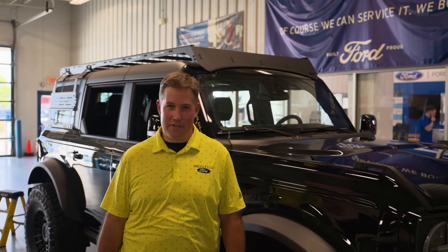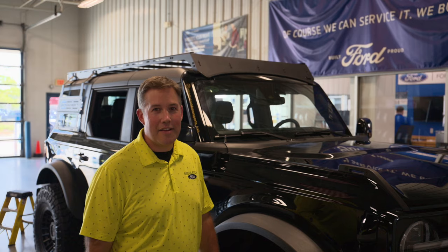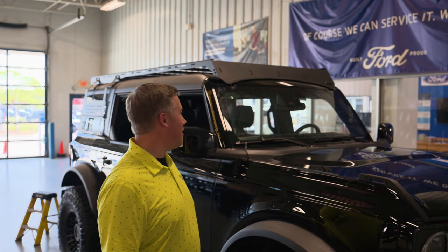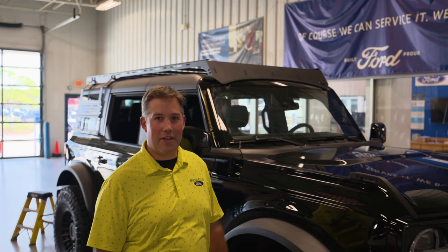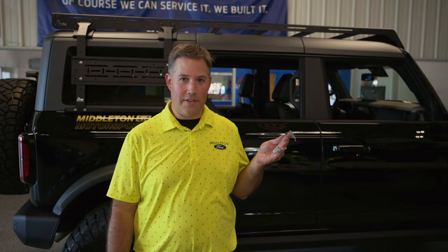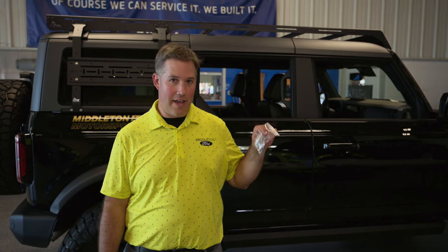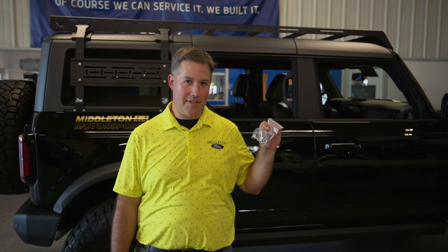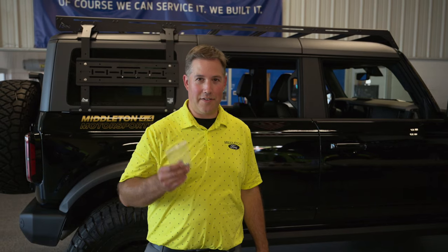If you made it this far on the video, hopefully you enjoyed your 12 beers and you're sitting back enjoying looking at this thing. It is definitely the best-looking roof rack, but it definitely was the most challenging install we've done on any roof rack so far. Make sure you hit that like and subscribe and please hit that notification button for any future videos. One thing I want to add: those slotted bolts that we had to cut earlier to fit the front mounting brackets, and the bolts bottoming out — they actually supplied carriage bolts in the package but there was nothing in the instructions about it. We did message them but they didn't get back to us in time, so we just ended up modifying it. Make sure you use the carriage bolts and it will tighten right up, no problem.